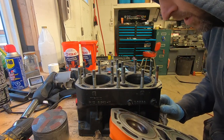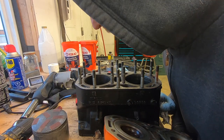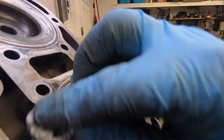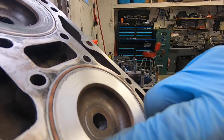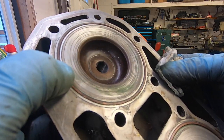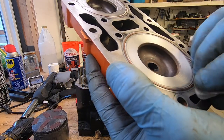It's in a good location — right in the middle of the cast cylinder liner. There's no more rounded profile on the bottom of the copper o-ring. It's nice and flat, which means it's squished and it's perfectly seated in that groove. That is a beautiful, beautiful thing. And we can find the seam — there it is right there.